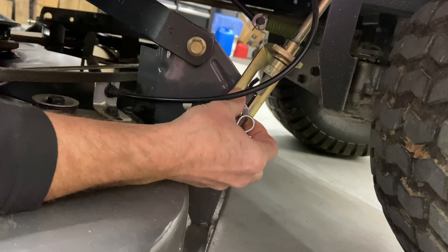Then the arm falls down. We have a front pin — take this one off; it's usually a little smaller than the others. Now this front piece: if you're going to use your tractor without the mower deck, definitely take this out — it will jackknife and bend if you don't. So now we're ready to move the mower deck out. We have a blade engagement cable here with a little clip that you push — then the cable falls out, and we can slide the mower deck out.